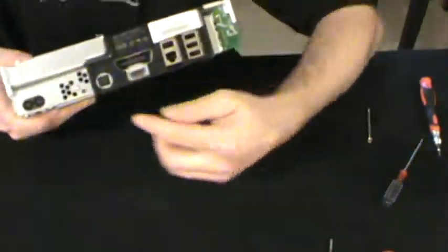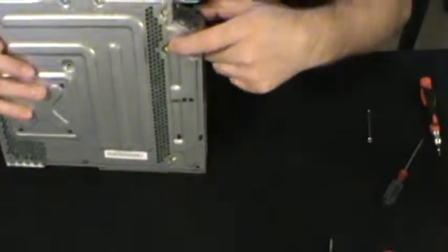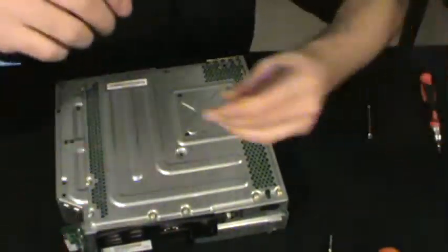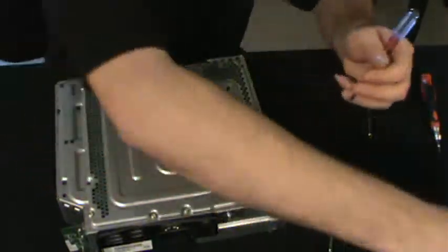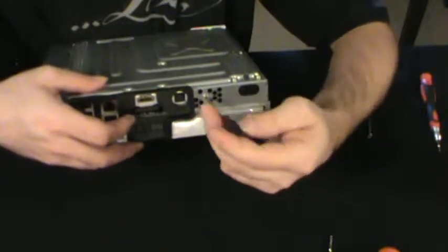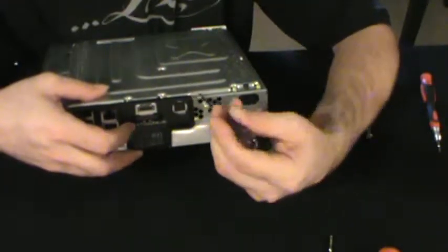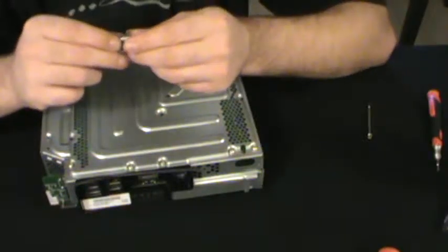To remove this black piece, there's going to be a screw here that holds it in place, and then also on the underside another screw right here that holds it in place. You're going to have to remove both those screws in order to remove this black back piece. This is a T10 screwdriver, by the way — used to remove the top shell housing and also used for all these bottom bolts and screws. Aside from the X-clamps, the X-clamps would be a T8.